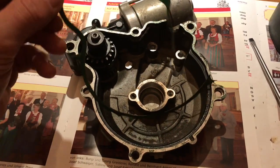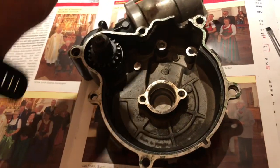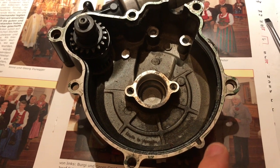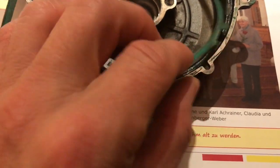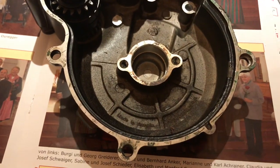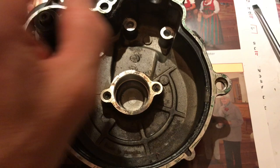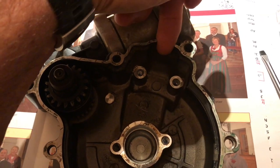We're back inside. I'm going to do the full wet mod — fill it up with oil — so I will have to get a new gasket because it needs to be all sealed. There are loads of videos on the internet; Jeff Slavin at Slavin's Racing did the original video for the wet mod. Basically this little vent here — the gasket just goes over it, leaving a little bit underneath so anything inside that casing can go out to the outside. The trouble is, in water and mud, water gets in and it's a right mess. With the wet mod, you seal that up with a nice new gasket and then here where the rubber grommet goes in, you've got a vent pipe that goes up underneath the tank.